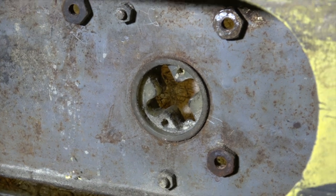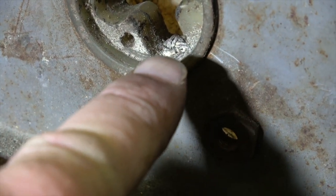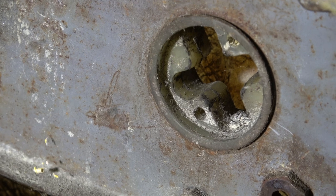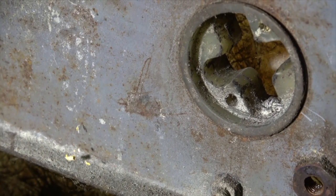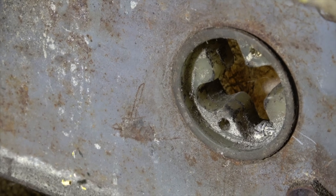On the other side of the motor there are two pegs which pull out of the mechanism for winding up and down the window. You can just about see the cable that raises and lowers the window, just tied off there. It's a plastic keyway that rotates from the motor and raises and lowers the window. You're supposed to keep that in the position of the window raised, but as you take the motor out it slightly drops. To try and get the motor in I tried for about five minutes — it's not easy. I can overcome that by fixing the window up into the frame when I need to.